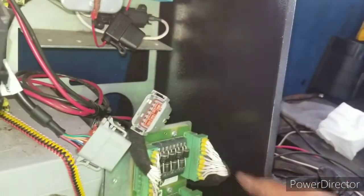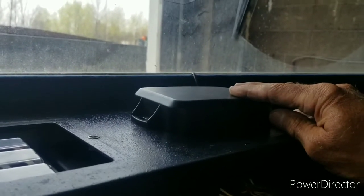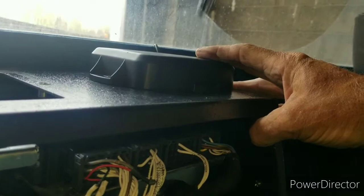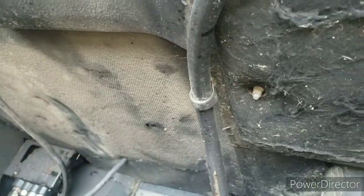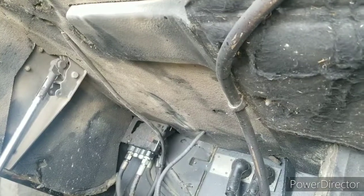This is a GR9 device right here. We ran the wire through the existing loom of the vehicle, underneath and up alongside, then mounted it and bolted it right there. When mounting with screws, make sure you use the proper length screws so you're not tapping into anything underneath — not damaging any other harnesses. Make sure everything is free underneath before putting screws in panels. You can see by the impression in the foam where the wires are sitting — you don't want to be messing with those wires or the heater holes, so be careful where you put those installation screws.